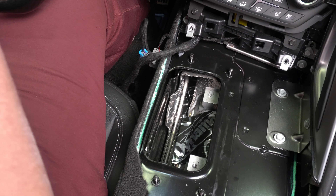The next part is going to be to remove the top of the center console. Scott is going to demonstrate. Typically I like to start with the pry tool down in this area, but really this piece is just snapped in — no right way or wrong way, just be as gentle as you can. You can hear the snapping sound meaning we are lifting it out. Be careful because there are a couple of plugs going into the parking brake and the mode select, and there's also another cable going into your 12 volt power. When you get to about this angle, you're going to want to pull back towards you a little bit and it'll release from the dash. Then you can reach underneath and disconnect your electrical connectors.